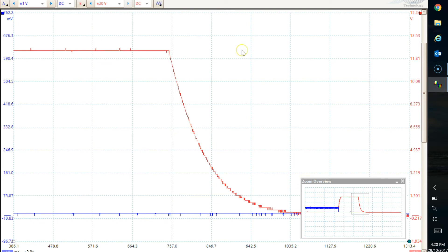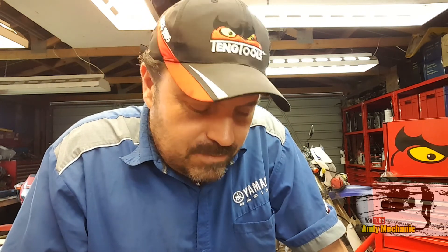Cool — it's bloody good, isn't it? Pretty simple, really. I'm just getting my head around it, but it's not difficult once you think about what you're looking at and understand the basics of how the component's operating. That's actually the first time I've used both lines on the scope, and it is really useful to be able to take comparisons and see the relationship between one signal and the other. You could be looking at two totally different components, two different sensors on the bike. And having that amp clamp is really, really useful — you can diagnose a lot more problems with it.